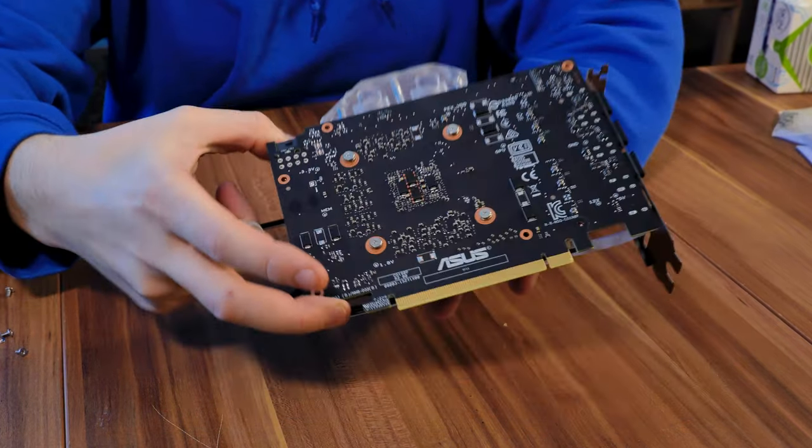So this was water cooling an ASUS 3060 Ti Dual Mini V2, which is identical to an ASUS RTX 3060 Dual (no Mini), using a Bykski water block called AS 3060 Dual X. That's the reason this is a bit weird — it says 3060 but this is a 3060 Ti, but it works because it's the same PCB. It took about 10 minutes, which is really very much all right. For the five people actually doing this to their cards, I hope this was somewhat helpful. Now I will proceed with attempt number five to water cool the LZX8 case — the project is still ongoing. I won't admit defeat. See you in the next one, bye.